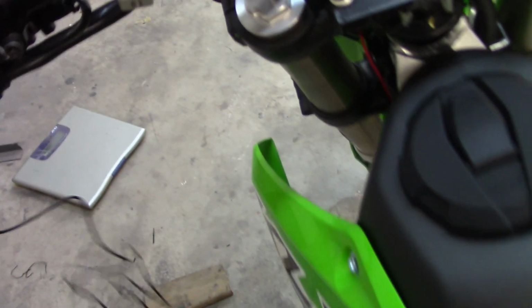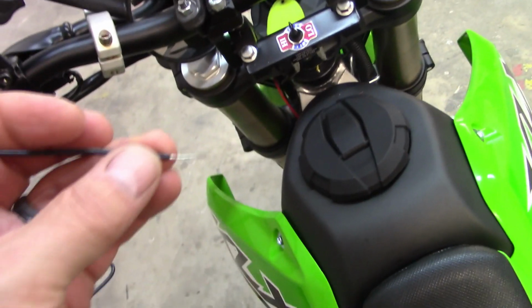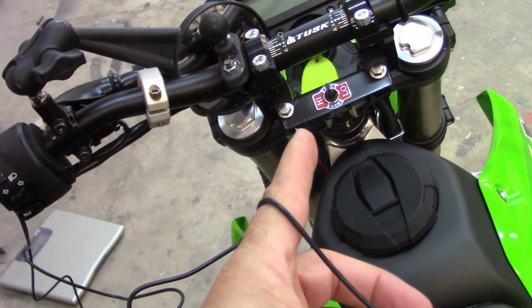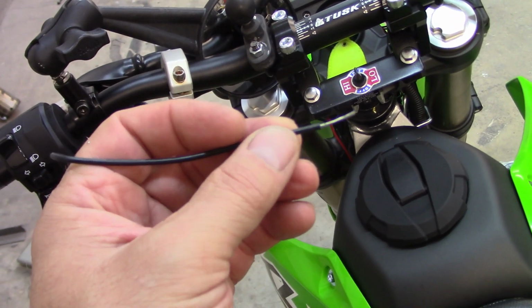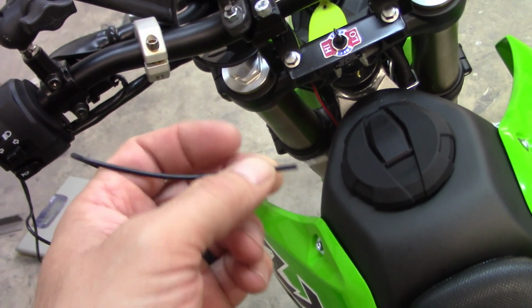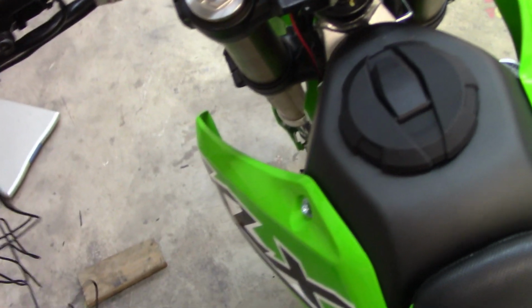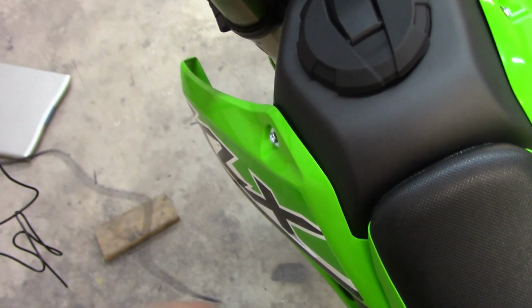Because one of these wires of each grip will get connected together, and you have to have them on a ground. What I'm going to do though is run them up into where the turn signal area is behind the headlight and crimp these into the ground wires on the turn signals. But all you need to do is take a bolt loose that is connected to metal on the chassis, and you can screw those in to that. Or you could technically run a wire the whole way back to your battery if you wanted to.